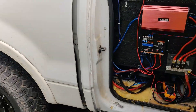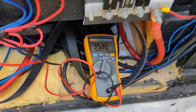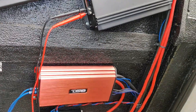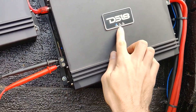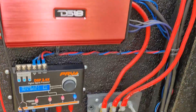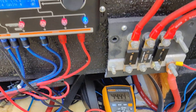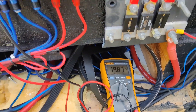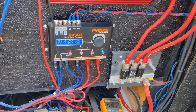Once you hit play, you're going to want to have a multimeter set up. We're going to be reading the output at the speakers — this is basically where your speaker wires connect. Once we have the leads hooked up, we're going to be looking for the clip indicator. You don't have to touch the gain on the amp. We're going to do this through the DSP. You can see as we go up, our VAC goes up, and if you go down, it decreases the VAC. We want to go all the way up until everything is slightly clipping, and then that's where we're going to set it.